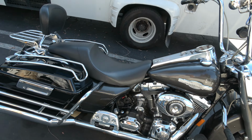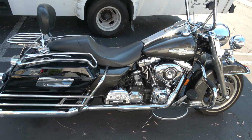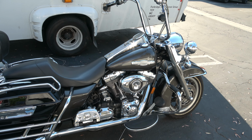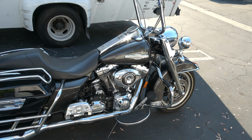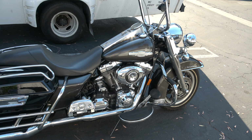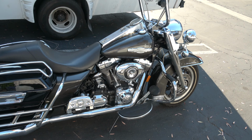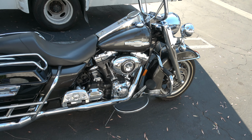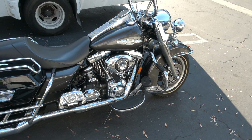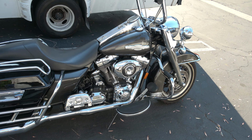So, one clown says, oh, don't buy a 2008, they're junk. I said, well, let me tell you what, pal. You better not buy a Harley-Davidson. Every Evo ever made had a bad cam bearing. Every twin cam ever made, you gotta inspect the timing cover and update or adjust whatever it needs in your chain, because they all had issues, every one of them. Even the later ones, you gotta have a look, make sure it's good.